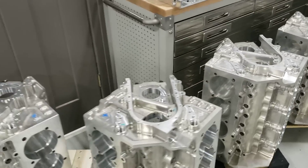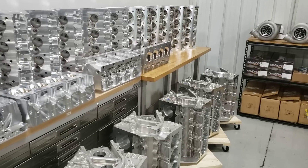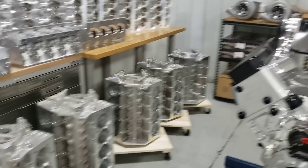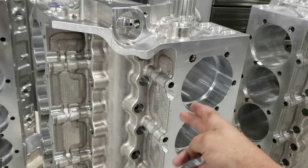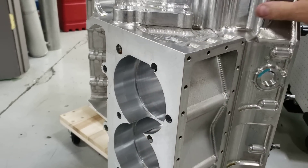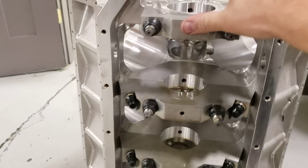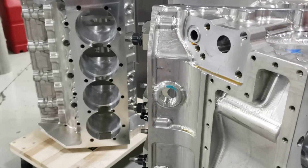You can see blocks in stock, and that's what I wanted to do — make sure that I have everything in stock so you have repairability, not some custom one-off deal. It's repairability. So we have blocks. New sleeve design that I've got on a Series 2 motor already. You can see all the water jacketing that's in here. No water comes through the deck surface at all — not through the heads or through the block. Main saddle, all that good stuff. Water in, water out. Oil in, oil out.